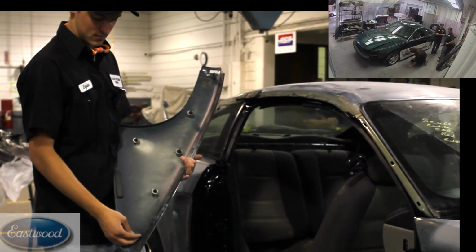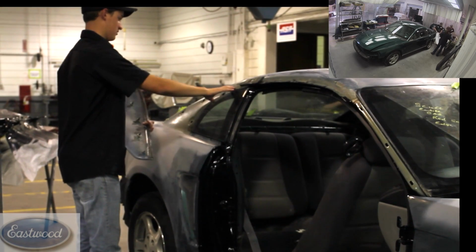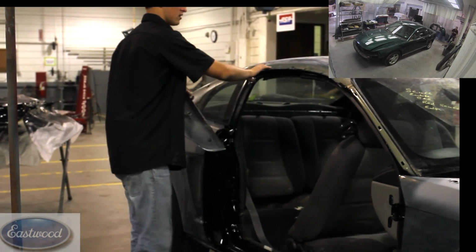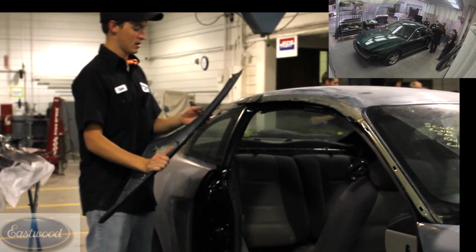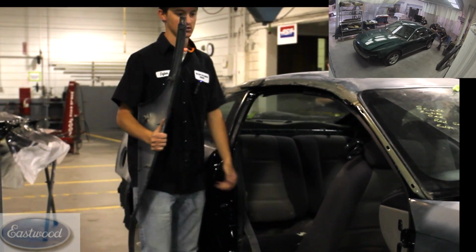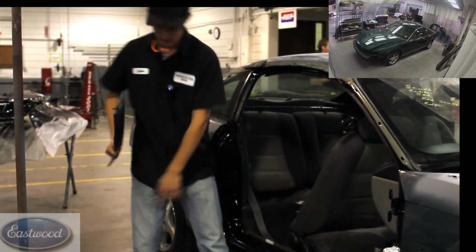There's this small clip that goes in right here, and then there's 5 right here, and then in this there are 5 screws and then 3 clips and 1 bolt. It has 10 millimeter nuts that go on the end of these, and then the other ones are just Phillips head, and I think this bolt down here is also a 10 millimeter to hold that on.